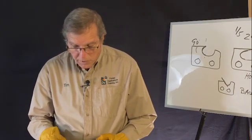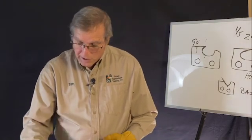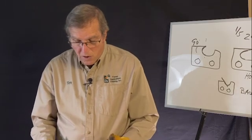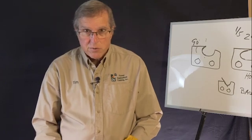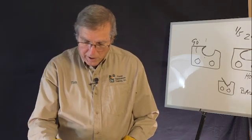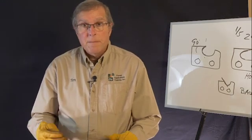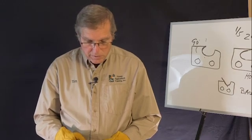And one thing you want to think about too is that you need to go the right side cutters and left side cutters separately. So you either need to turn the saw over or turn it around. You always file from the inside of the tooth to the outside, and that gives you the chrome kind of coming off on the outside edge, and as soon as you put it into the wood, it'll actually clean itself up. So very important to think through.